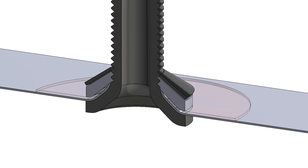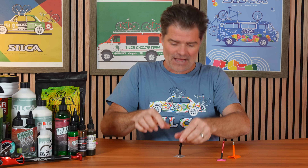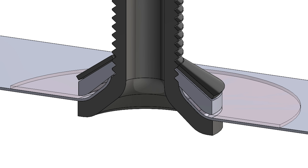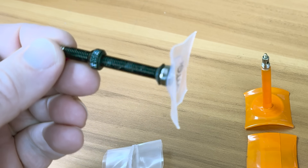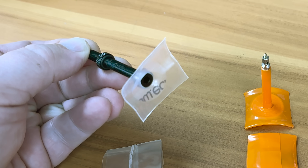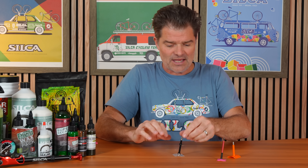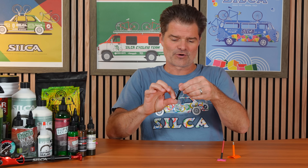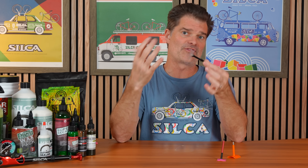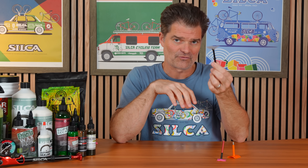As we zoom in on that cross-section, we see there's a flange. The TPU goes over top of that with a little bit of glue, and we then thread down another aluminum flange over top, sandwiching the TPU material with a protective disc that protects from any rough edges at your valve stem. This gives us a 10-millimeter flange — the largest valve holes can be by spec is nine. We've got a little rubber flange on top, so you should only ever have the protective rubber gasket, then the aluminum flange, then the TPU material behind that.